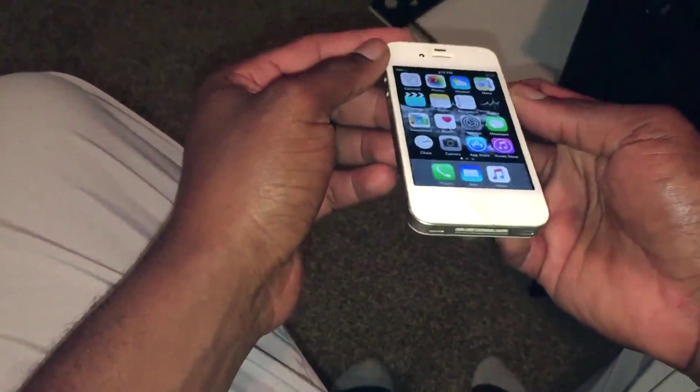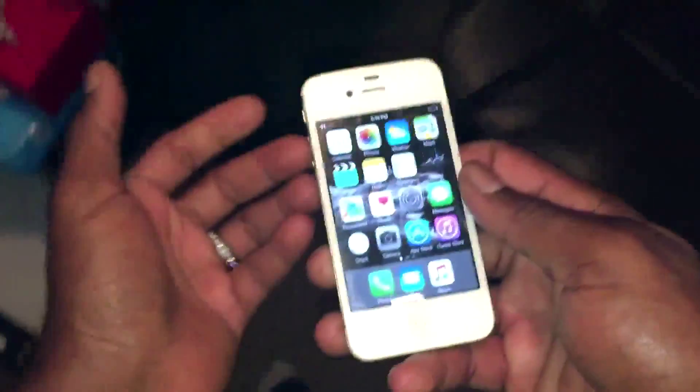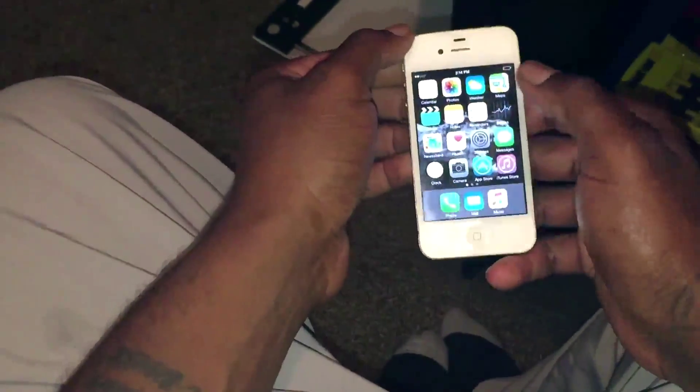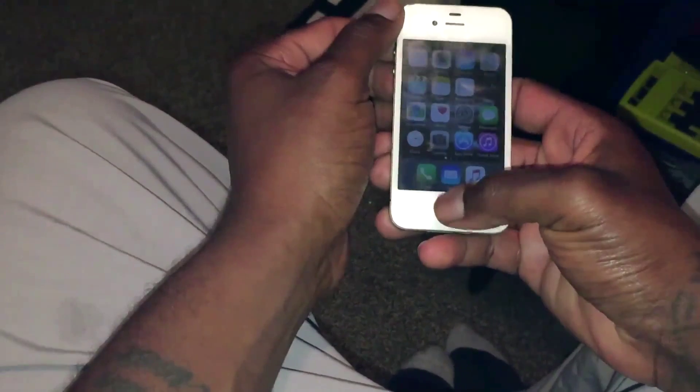After that, you want to plug your device back into the charger at a wall outlet — I'll show you right there, there's a wall outlet. You want to take your phone and charge it back up to 100%. So to recap: make sure the phone is at 100%, drain it all the way down to 0% until the phone shuts itself off, then charge it back up to 100% without any interruptions. Then you want to reset your device by holding down both the home button and the power button until the device restarts itself.